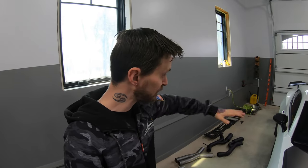It's if you can get it to flow out, because not only are the pistons driving the exhaust fumes up, the exhaust valves open, and then it's forcing it out of the head, but you also want the exhaust system to act like a vacuum effect and suck the exhaust out of the head and push it out the tailpipe. If you can have that scavenging effect act properly, and you don't have misses where you've got an exhaust over here and then over here, you got this big gap in the middle, that's where you're gonna lose power. That's where you're gonna get that boxer rumble. That's where you're gonna get maybe a V8 grumble, and you're not gonna have that exhaust go out quickly enough.